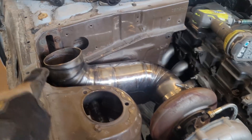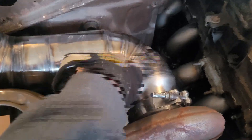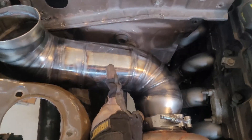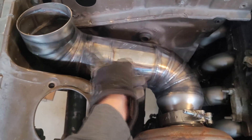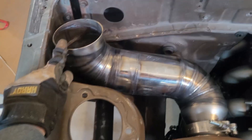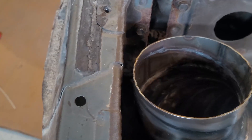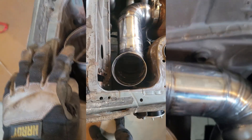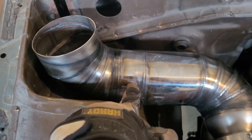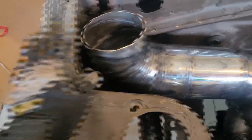That's all welded together. The process was: v-band on, put this on the v-band, get the initial turn so we can make this corner, and then I put on this piece to here — that way it was easier to judge the distance. Once I had this all together, I made the second bend. That gave me a distance so I could have a nice tight tolerance without running into anything. I held it in place and then measured out this little filler section. All that section did was bridge the two pieces once made, so I could get the fit where I wanted it.